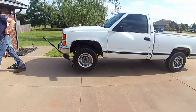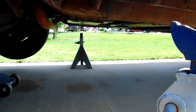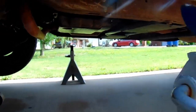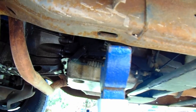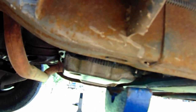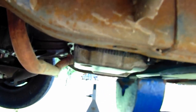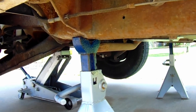It might be high enough. Always remember safety on these things. We're gonna go ahead and put the jack stand up underneath here. I like to put it right here where you see the welds and the frame go together. That's one of the best places I've ever had luck with. And just raise it up as much as you can to get you some work done. Put that notch in and go to the other side and match it. Sitting good right there. We'll just work with that.